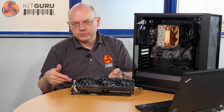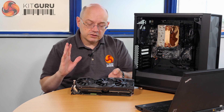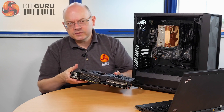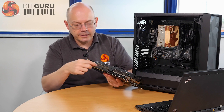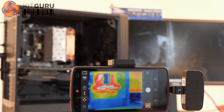With the AMD reference card, it struggled under heavy load. AMD allows up to 83 degrees; ASUS aims for 75. So it's aiming to be cool and quiet. The 2.5-slot design means that once you allow for capacitors and such like, the extra half slot gives them around an extra 40% of working room in terms of cooler thickness. It might not sound a huge amount, but it does make a massive difference.